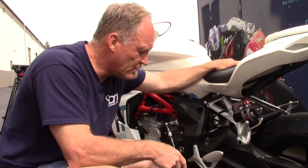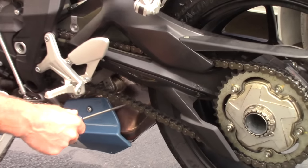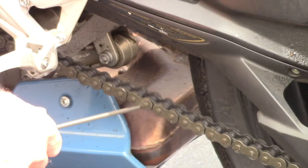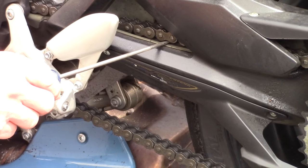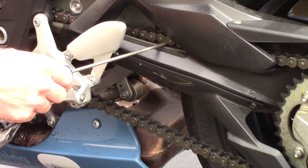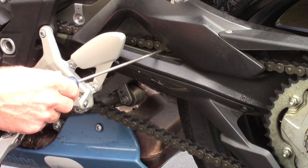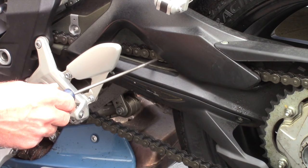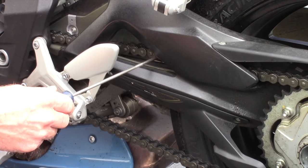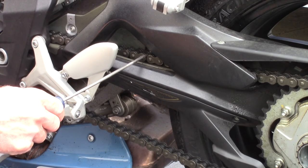Here's the screwdriver. You want to go behind the footrest and lift the chain up, but what you don't want to have happen is that as you stretch the chain, the top chain moves up. As soon as this starts to move, you're cheating and forcing the chain through a further range, actually stressing it up there. So the top run must stay perfectly still.